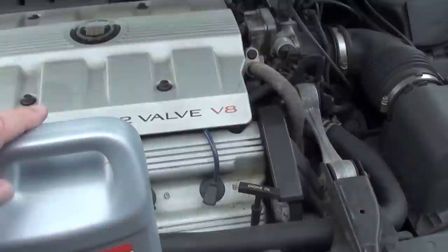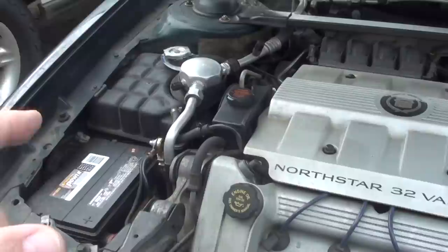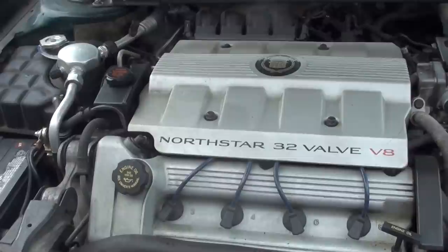Sometimes there's a leak between the heads inside your engine. You'll notice because you're burning a little radiator fluid — the level is low and it's going somewhere. That's not supposed to happen, so you have a small leak somewhere.